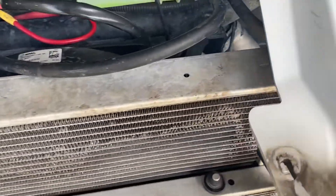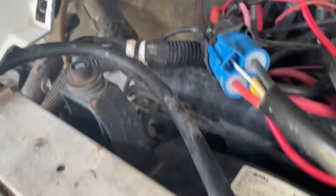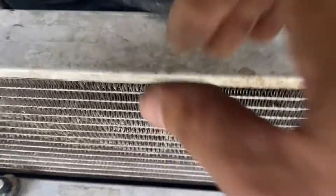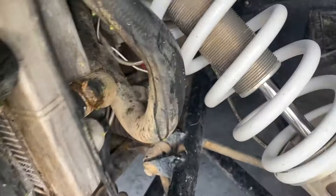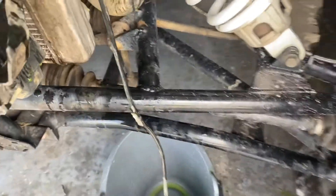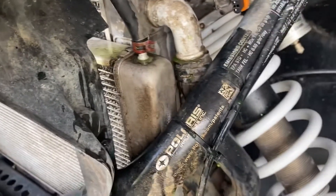We've got the little brackets out — they literally just pull out once you get the bolts undone. Now I'm going to take off these two little lines connecting to the overflow for the radiator. One goes there, one goes to the auxiliary, and then these should pretty much slide right out — they're real loose right now. I took the first one off and no real coolant came out, but the second one is under pressure so I put it back on. We're going to release the lower coolant hose off the radiator to start draining into a bucket to release that pressure.